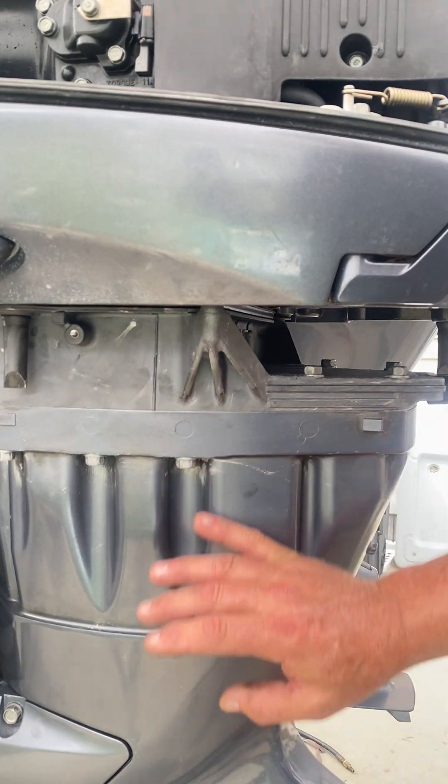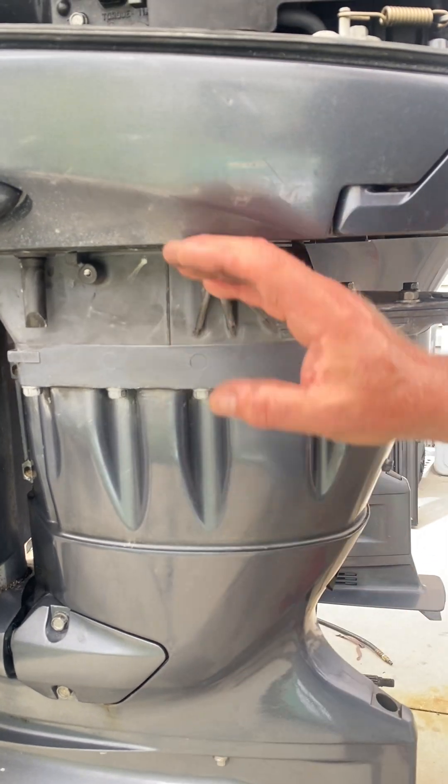It took a full day to get the power head off and probably a full day to rebuild the midsection — there's a muffler assembly, a tube going down with rubber components, several parts. I replaced everything: all new gaskets, all new rubber boots. You could get away cheaper but I wouldn't recommend it. I even replaced the exhaust plate down here, probably didn't have to but I bought it anyway. Bottom line: the old Yamaha 150 does not like low RPM time, and Yamaha, you should be ashamed of yourselves.